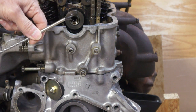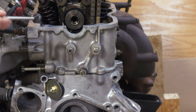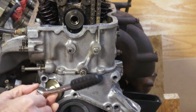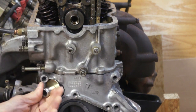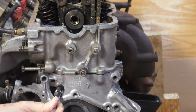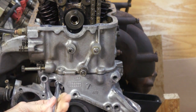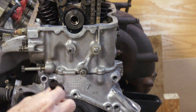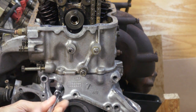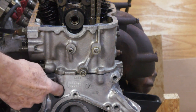To get the piston you can use one of these tools. If you want to use a magnet, these tools will also hold one of these magnets. There's the piston. To remove the tensioner fasteners, we can take this plug off of here — that gives access to the hydraulic tensioner fasteners.